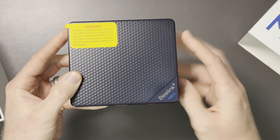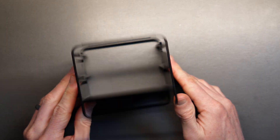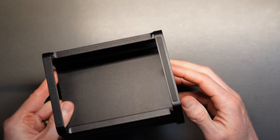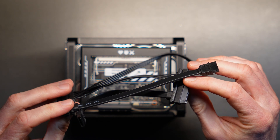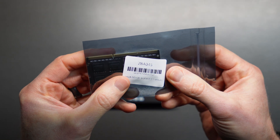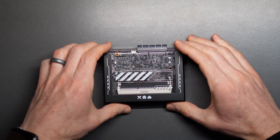You could instead choose to get something like a Raspberry Pi or an x86 mini PC, so why would you choose this? It became clearer when I saw this — a NAS kit designed just for the Zima Blade. You can get this compact two-bay HDD rack tray. It accommodates two 3.5-inch storage drives, and there is even a custom SATA Y cable for connecting two drives to the Zima Blade. The NAS kit also includes 16GB DDR3L memory, a mini DisplayPort cable, and a power supply.